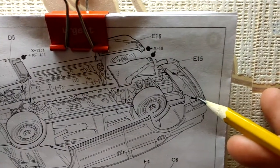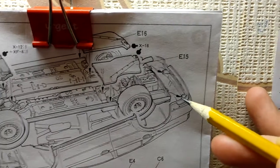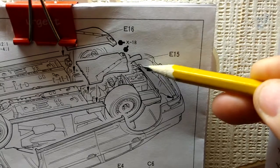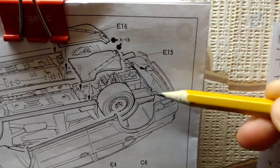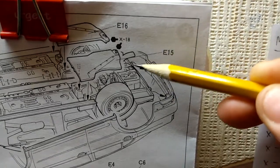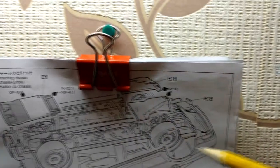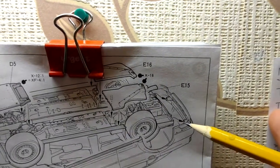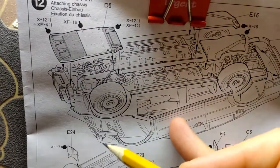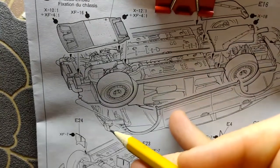on the rear bumper here, a little mounting square with a square C-shape cutout. And them C-shapes line up to the back lip edge of the rear, just under the exhaust. So what you do is you put it in rear first, and then you bring the front down, and there's two more of those square C-shaped clips in the front bumper just behind the headlamps.